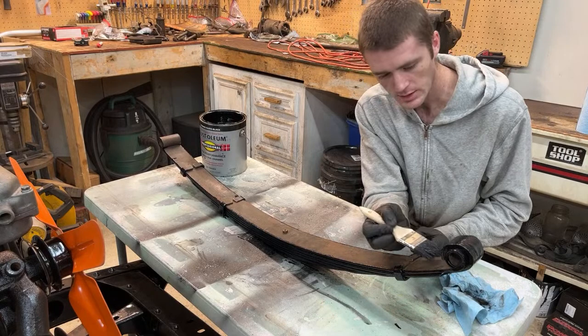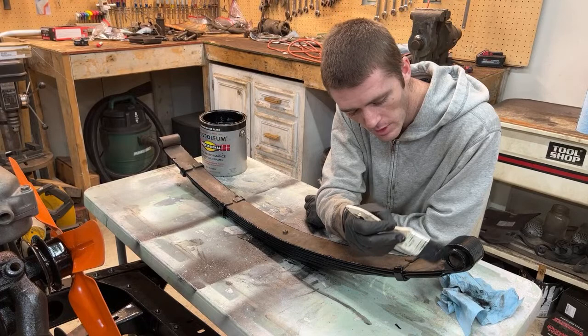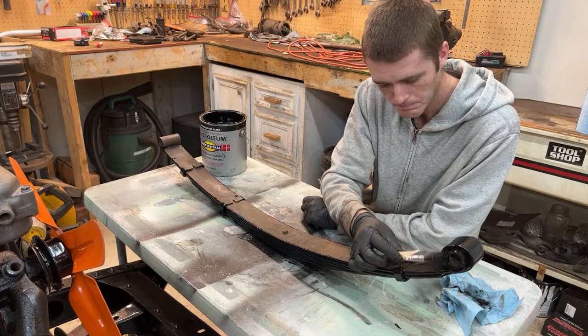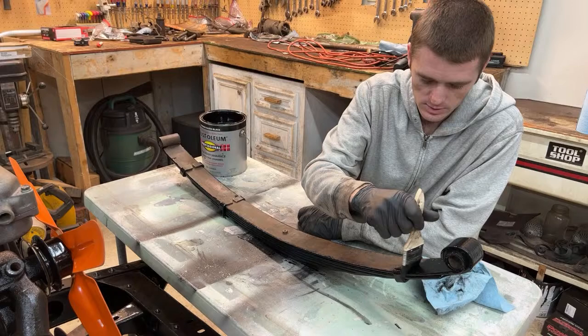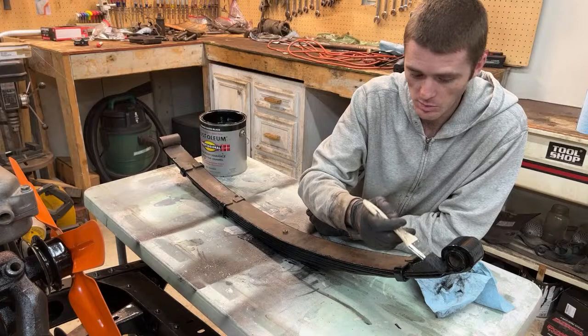Oh, I might do a separate video on rebuilding one of the brake cylinders for the front brakes here. Took one all apart, and the funny thing was it was seized, but the little seal inside where the brake fluid pushes against, it was fine. It was just the piston that seized to the wall. So I got that out, and then I just used a little wheel cylinder hone and honed it out, and then I did emery cloth on the cylinder itself and cleaned them both up. And now it works fine. So I did that to all four of them for the front.